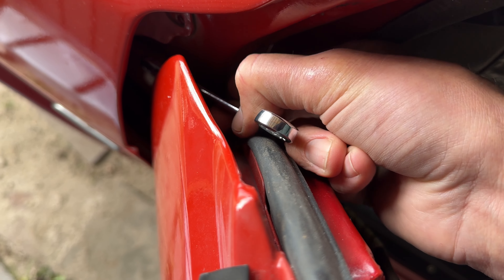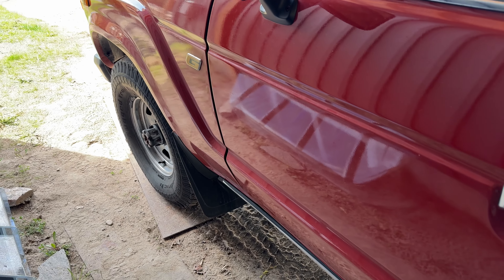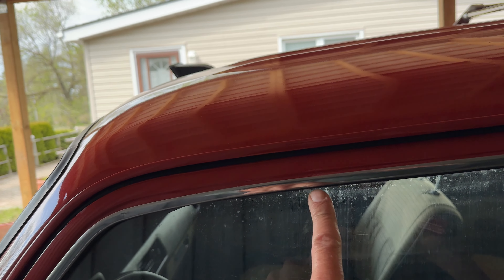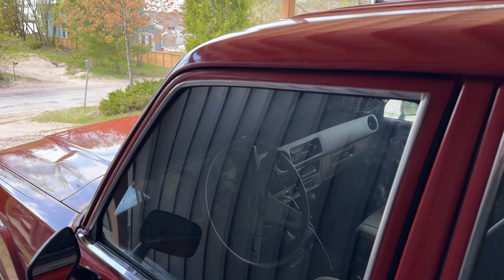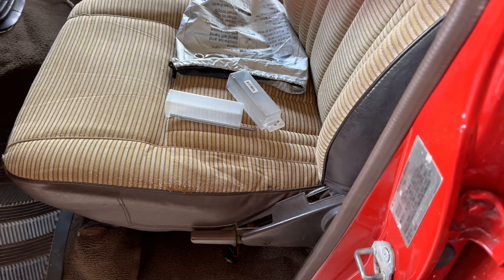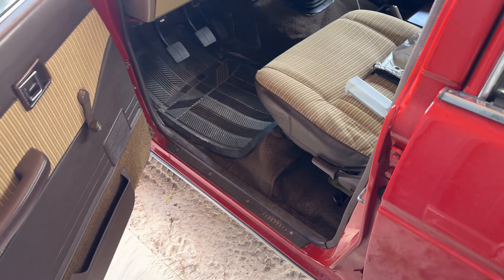I'm just snugging it up now, and I've got to do the ones on the door too. That's it — it's pretty good, not perfect, but way better aligned. It's a little bit tight up here because at one point a tree fell on the door, apparently, so I've straightened it and put it on. Nevertheless, it's aligned. Cheap tool used. And don't forget you'll probably have to adjust the striker as well — use your JIS screwdriver, take that off, adjust it where you need it.